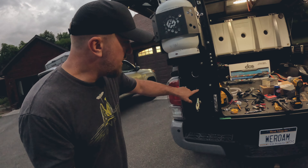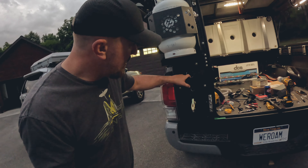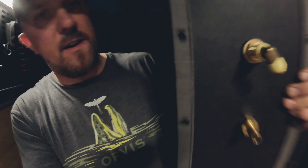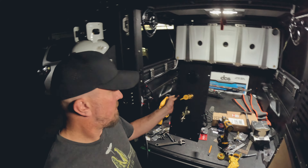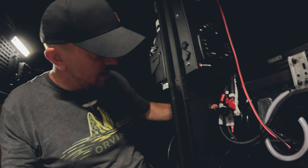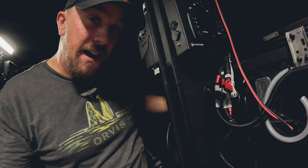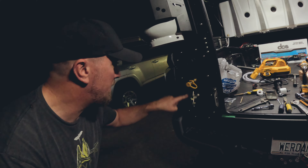I thought I was just going to do the water but after looking at how all this comes together, I want to be done with the project. I've evenly spaced them out so they look nice. I'm going to mark the holes and drill — a two-inch hole saw for the NOCO, and a 7/8ths-inch hole for the propane line. Now I'll actually angle the propane line off to the side. Once the LP quick connect is attached, I'm going to put the NOCO on. If you buy hardware, don't discard it — keep extra hardware, because this little gasket from a peanut butter jar of rubber gaskets just happens to fit perfectly. NOCO, LP, water — we're good to go.